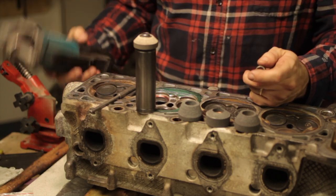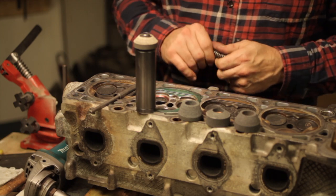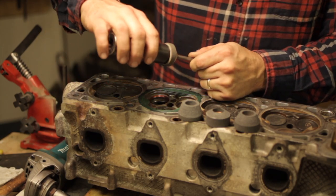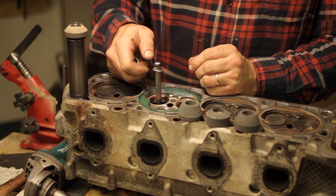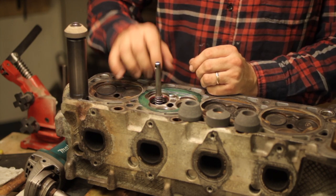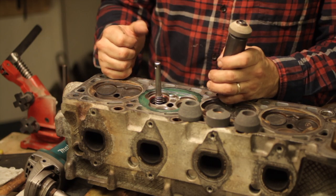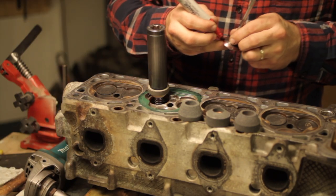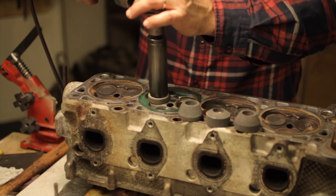It's a little bit of a learning curve trying to get this stuff to work well for you. The pilot is the size of the valve guide on one end and the size of the stone holder on the other end, so it slips down into the valve guide. You'll need a washer on top to keep the spring from spinning and gouging up the ports. Once you're ready to start grinding your valve seat, just get a Sharpie marker and mark the seat all out. Mark the face of the valve also, and then make sure your movements are very machine-like — try to articulate as perfectly up and down as you can.